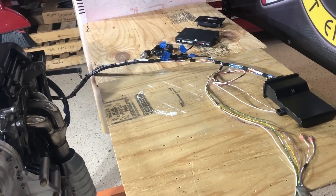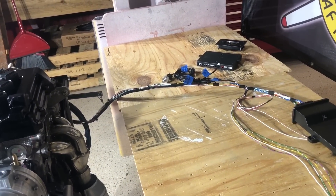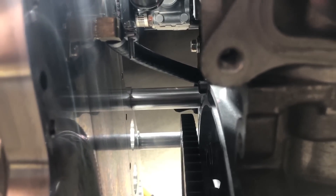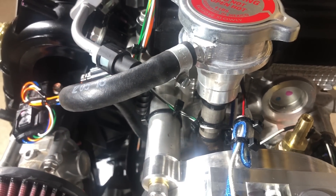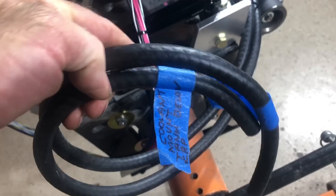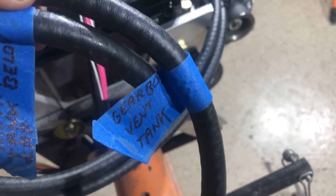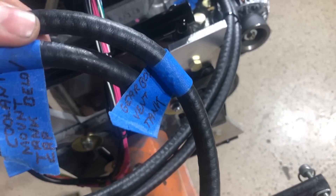Once the wiring is done, there's fuel, coolant, and gearbox vent hoses to hook up. Behind the gearbox there's a vent line — a quarter-inch hose coming right off the back of the gearbox. There's also a quarter-inch hose off your thermostat housing. Both hoses are already installed and labeled; one goes to a coolant bottle on the firewall and the other goes to a gearbox vent tank — to catch any residual gear oil that may come out at maximum RPM so it doesn't get on anything.